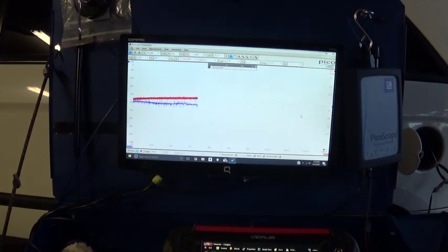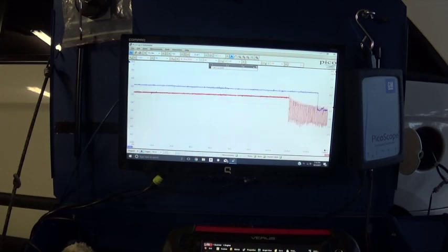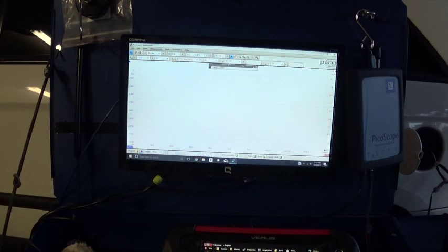Now pretty soon the switch is going to open. I don't like this line on this switch because my other one was doing kind of the same thing and it was a bad micro switch, but this is definitely another issue. Now the switch starts to open, and I don't like to see this either. All this change in voltage, it should be pretty steady. Seems like we might have some issue with the switch as well, but definitely a problem with a leak somewhere.